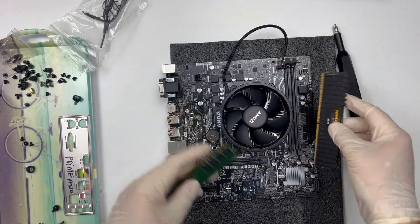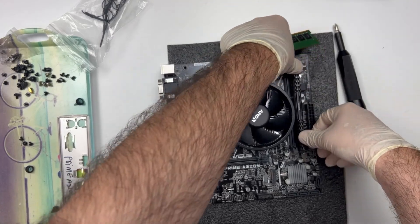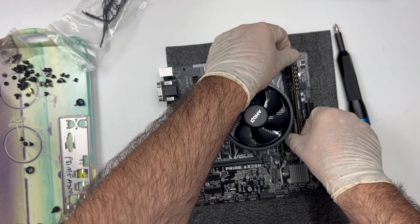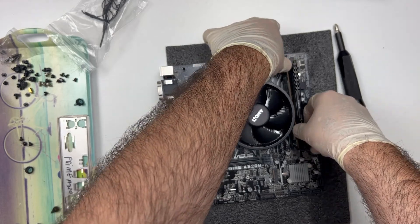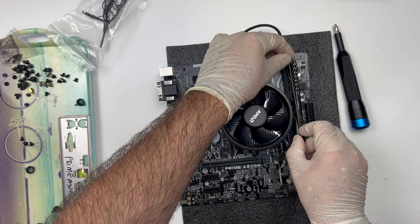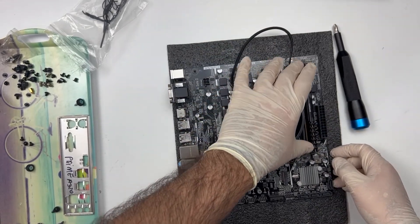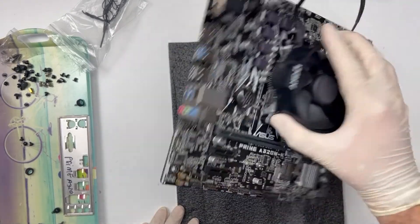Well that might have been a little white lie because the RAM I will be using consists of 2x8GB sticks of DDR4 rated for 2400Mbps. They are not part of the same kit but they do play nice together and work flawlessly at 2800Mbps with 1.35V with looser timings and 1.38V with super tight timings, so I don't really have anything to complain about here — except to admit that this is technically overclocking.